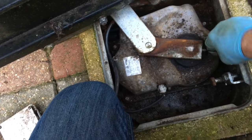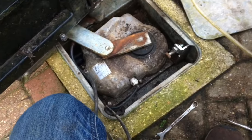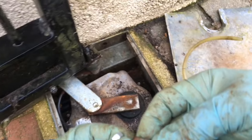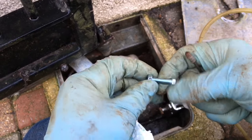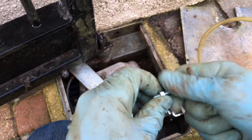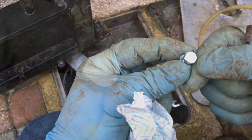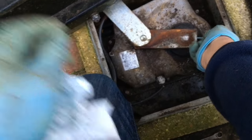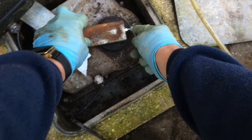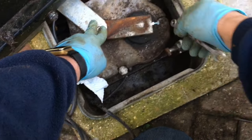The control arm should be held tight by this tiny little hex key bolt on the end, but it's not really tight enough. What's going to be better is to change that little hex bolt to a proper bolt that you can tighten up a bit better, and also put a lock nut on it. I found one in the garage that happened to be the same thread — it says TMS 8.8 on it, so it's a 10mm, probably standard metric bolt. Give your control arm or the gate a bit of a wiggle while doing up the bolt and the lock nut to make it a little bit more secure.